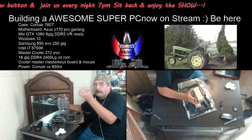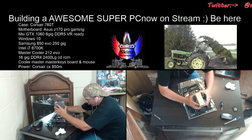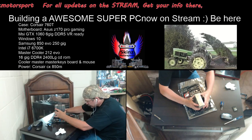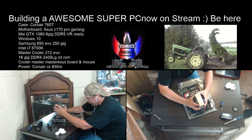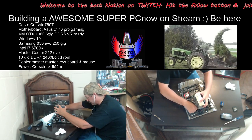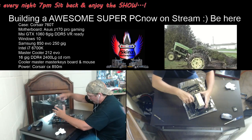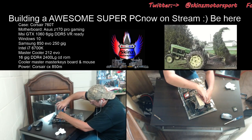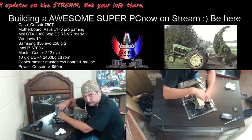Now we carefully, and I stress this, you want to carefully dab this over your processor without sliding it in either direction, tightening up each screw individually on one side, then the other. And now we want to take our screwdriver and tighten down our master cooler to the motherboard and processor. Be very careful not to over tighten the master cooler on your processor because you can damage it.